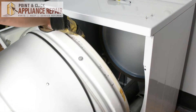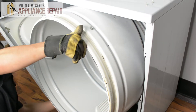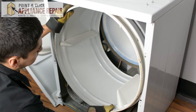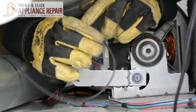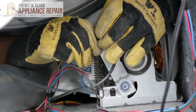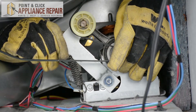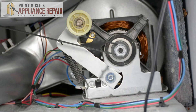Now we can put the drum back into the machine. As we put the drum in, just make sure your belt goes along with it and doesn't get caught on anything — it's pretty loose on here. To put the drum back on, we're going to take the belt, go on the other side of the wheel, lift it up, keeping everything together, and then loop the belt around the shaft. Make sure everything's on straight — everything should be able to spin freely now.